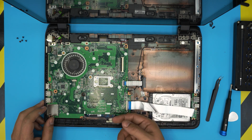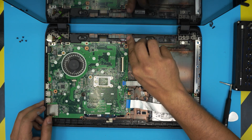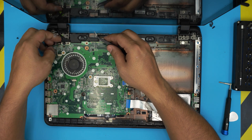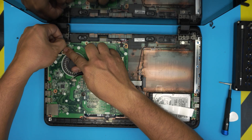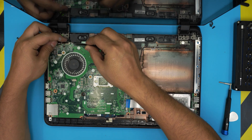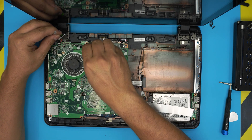To remove the ribbon cable for the audio jack, lift the cable and pull out the DVD ROM jack to disconnect it. Disconnect the speakers by pulling the jack backward. For the LCD ribbon cable, lift the locking tab upward toward the ceiling, hold the motherboard down with one finger, and pull the cable out. If it's very tight, use tweezers under the jack corners to help it out.